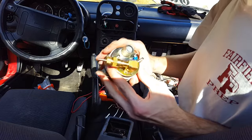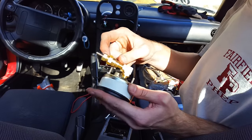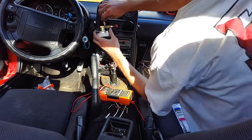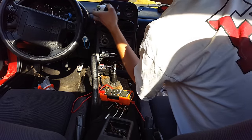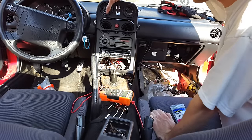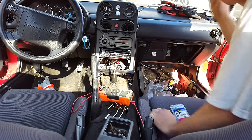Here's all the nonsense I have to do just to get this Auto Meter gauge to accept a vacuum line input. I had to go: 1/8-inch 90-degree elbow, 1/8-inch coupler, 1/8-inch to quarter-inch reducer, then a quarter-inch to 1/8-inch barb — and hopefully this all fits behind here, which is why I had to angle all this stuff so it sits nice. I hook the vacuum line up and oh yeah — it just fits, with the fittings literally against the dash. Before, everything was trying to go straight back with five inches of stuff, but now with the angle it'll fit and work.